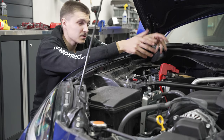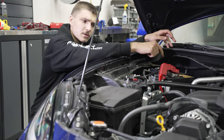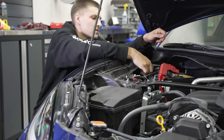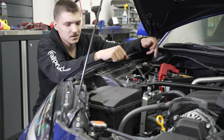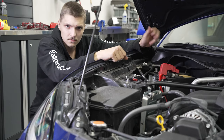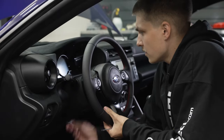...just in case, we don't want the airbag to go off. This is a money-making face right here — we want to keep this face safe. Go ahead and loosen the nut on your negative battery terminal, pull it off, and just make sure it doesn't get the opportunity to touch the post on the battery again.